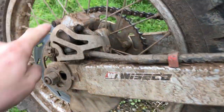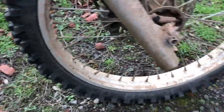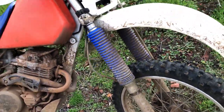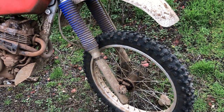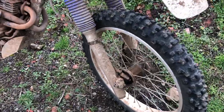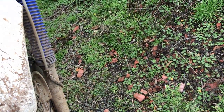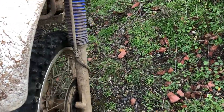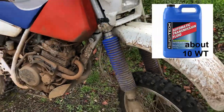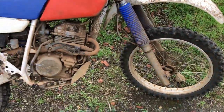That's the 1990 caliper, and this is a 1990 front end because the '86 suspension is a little different. I heard that the 1990 to 2004 suspension is way better. Although I filled it with ATF fluid and it's really sturdy, last time I was riding my wrists were killing me — I need to put a different weight oil in there.